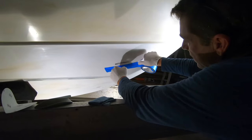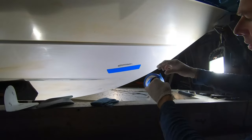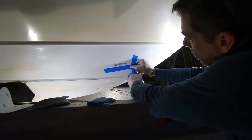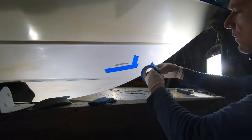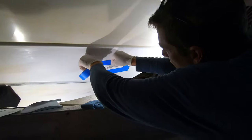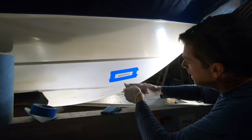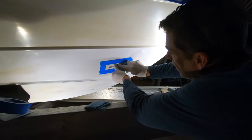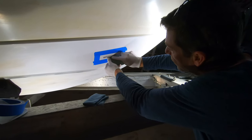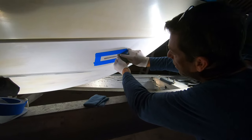I'm going to re-tape this and move it out just a little bit further, bordering where we're about anywhere from a half inch to three-quarters of an inch away from the damaged material. Then I'm going to take the 80-grit once again and just carefully go out just a little bit further, trying not to damage the edges of the tape in the process.